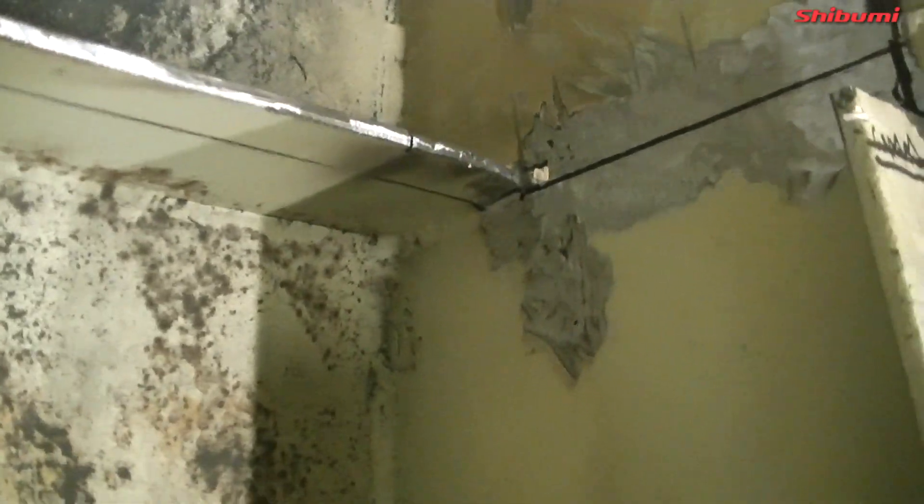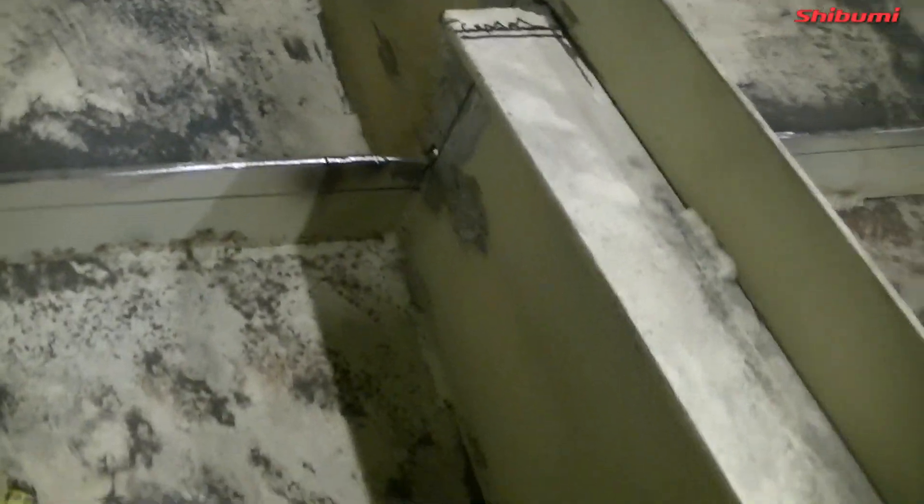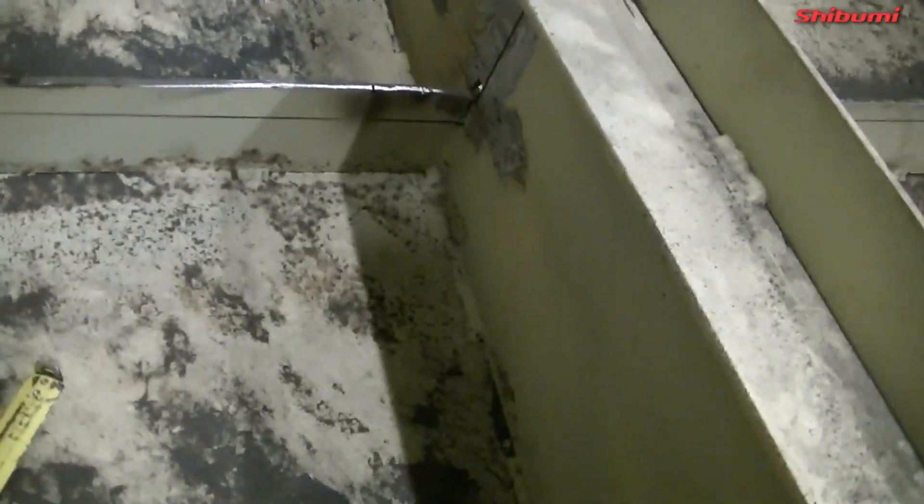I'll just make them because I still need to keep continuing cleaning out the floors and re-welding everything. I've also got the drill holes through here to get a continuation of this piece and to get that welded to the floor - to stop leaks up through the seam here and out here. We can't have that; it has to be clean lines all the way through.